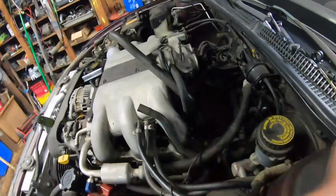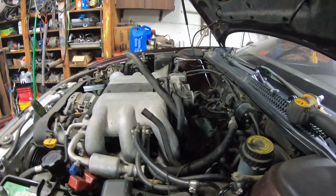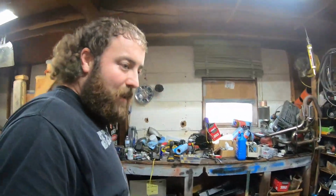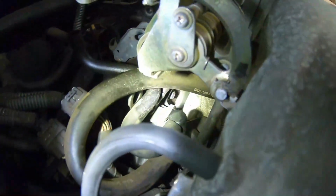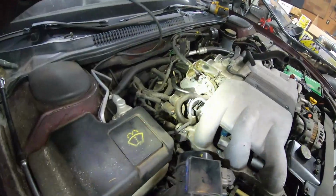Got the transmission. I think I already told you that, but I got the bell housing bolts out. We got a little gap going on here. But the torque converter bolts, you have to access from this side. But I'll let you look. Right where the torque converter's at, there is a rack and pinion and a cross member. So those bolts are damn near inaccessible. So I found, right there, there's an inspection window. Down in there, you see that bolt? So if I go from here, I can almost get it with a long extension, but it keeps rolling off.